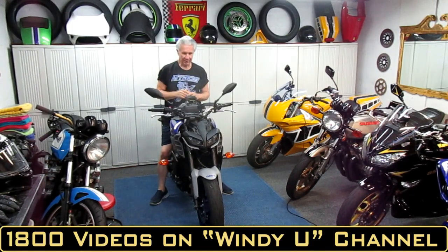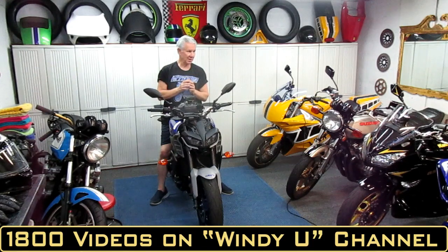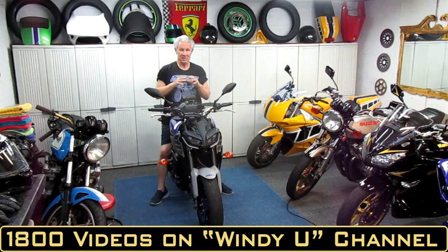Now, from looking at the video, and this is what I try to do every day with the video, I try to look at it and say, what can I improve? Now, one of the things on this particular motorcycle, the sound does not come out authentically. 2 reasons. Number one, it's a quiet muffler. When you have a motorcycle with a loud muffler like the Kawasaki or the R1 when it had my exhaust system on it, the one I made, what happens is the exhaust overwhelms all the mechanical noise. Well, on this bike it doesn't, and you hear the wind noise and you hear rattling of parts around here, and it's actually something I want to work on.